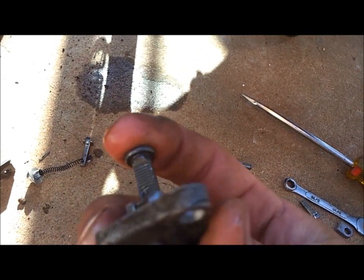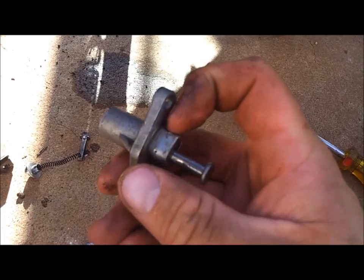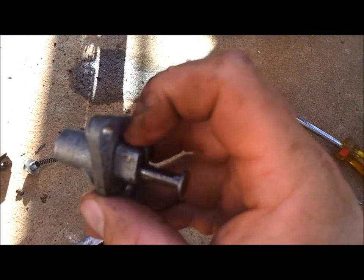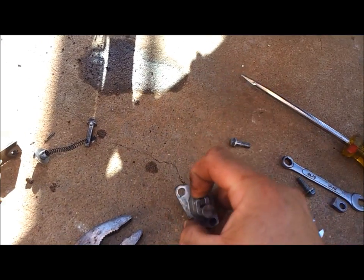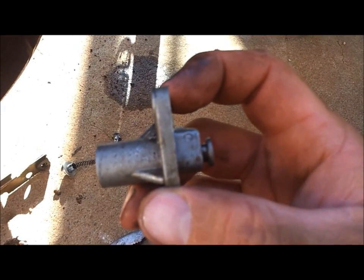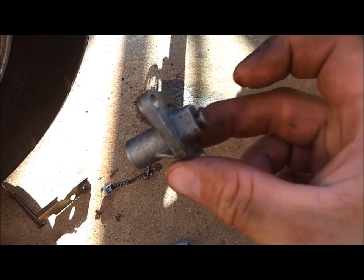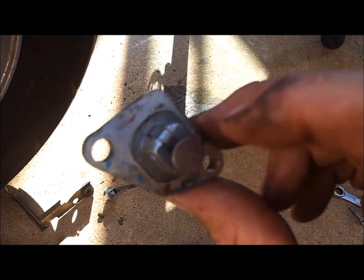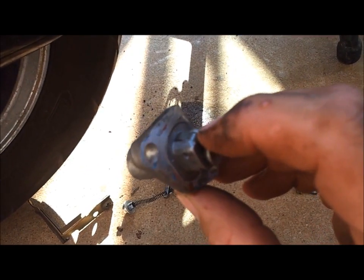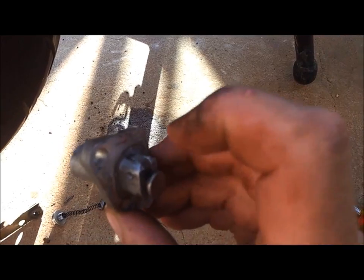Then we have to reset this before we can put the chain back on the cam sprocket. So there's this little jaw clip right here. Mash that down with your finger, or with a screwdriver or whatever. Mash it down, open that up, and then you can just push in this little rod. And now we're ready to adjust the tension back on the chain again. That gives us slack so we can put the chain back around the camshaft sprocket when we put the camshaft back in. You can do that same procedure while it's still inside the cylinder wall. If you've got a couple of long handle flat head screwdrivers, you can actually reach down from the top here inside that area and do the same thing I just showed you. I just figured it'd be easier for you to see exactly how that works with it off.